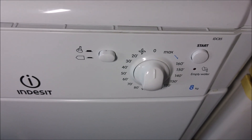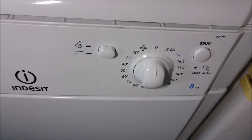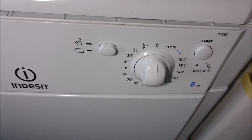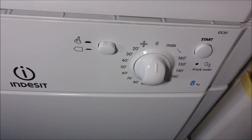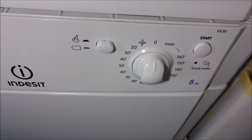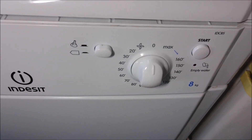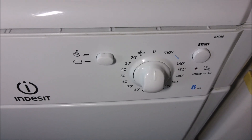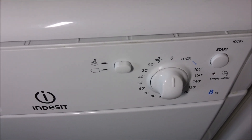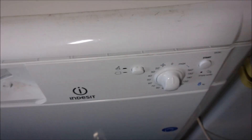One of the first things to look at, after the fuse and the connections etc., was the start/stop button. So I took it apart, got the new start/stop button — the micro switch — installed that, and still nothing. As I was beginning to replace the top of the lid, I just happened to notice something in the top corner at the back. I'll show you what I found.